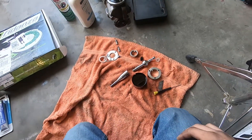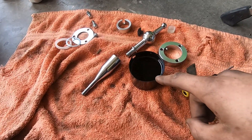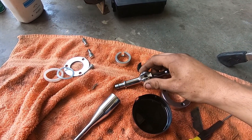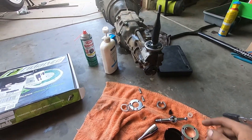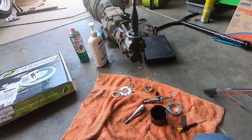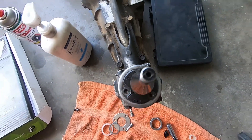So let's get in there and get this all assembled. First thing you're gonna need is a lot of gear oil - when you're assembling this you want to assemble everything with lube. Let's get these 10 millimeters off real quick and we'll go ahead and jump into that. Once you get those three bolts off you can just literally lift this straight out.